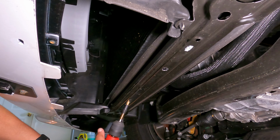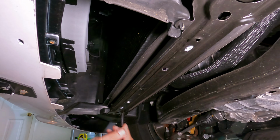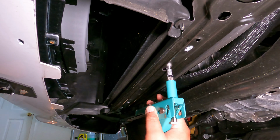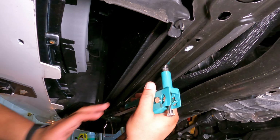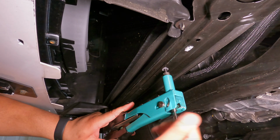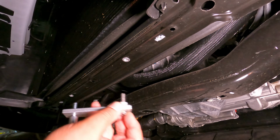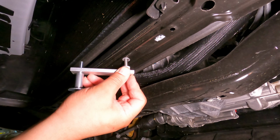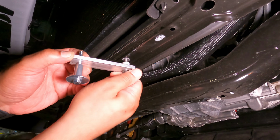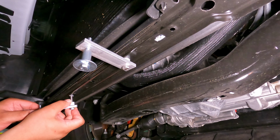Now, once the holes are drilled, insert the rivets from the mounting hardware and secure them using the riv nut tool. So now at this point, you can go ahead and screw the brackets in. You start by hand and then tighten them down with the 7/16 socket. You want them to be tight and facing forward. Now the spacers are still going to allow them to be moved because you're going to have to position them a little bit later.